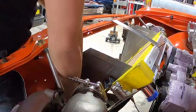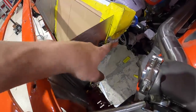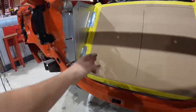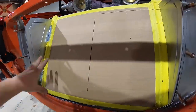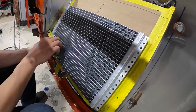Our radiator is now installed. The top rack is finally out of the way, side plates are bolted in, and I cut back some more material on the sides so now the full width of the radiator is inside our box. Before we put the intercoolers in, I have to put in the AC condenser core so I can account for its thickness when bringing out the intercooler.